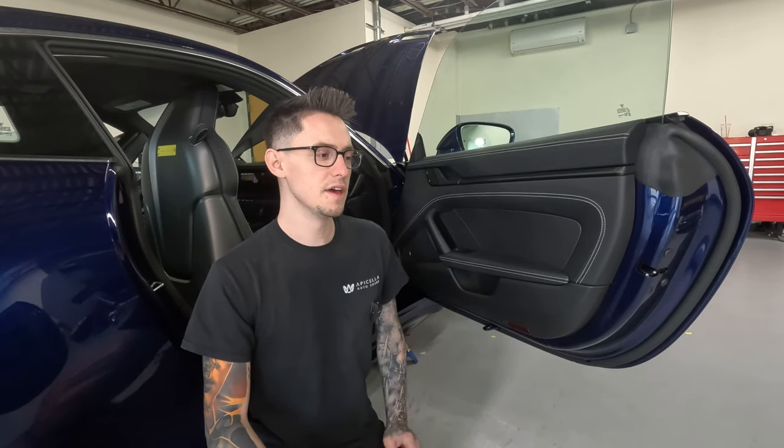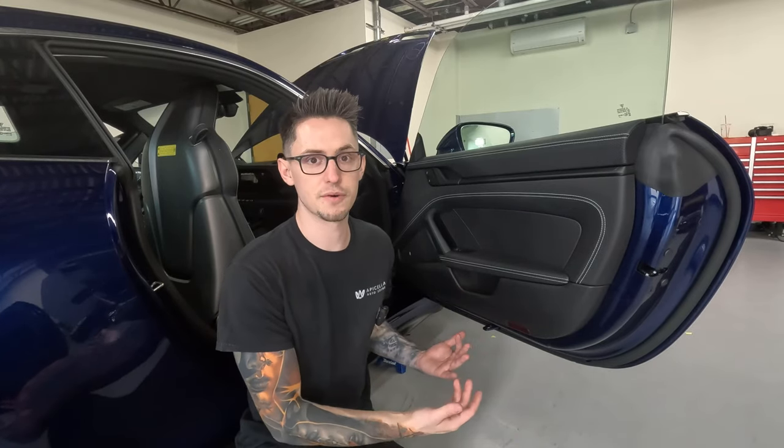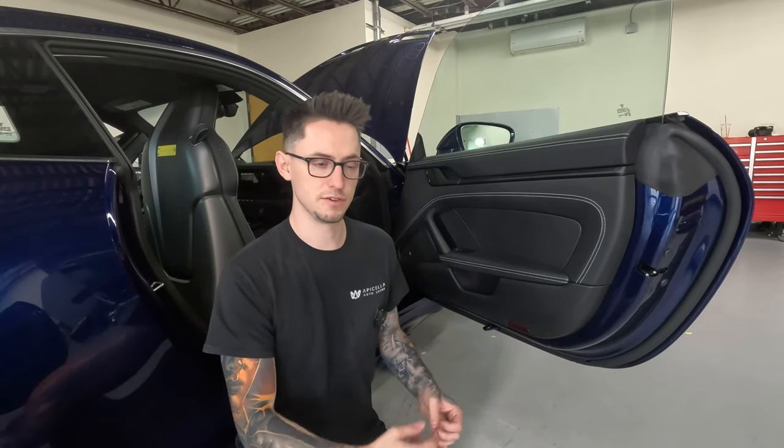The ResoNix CLD squares are a constrained layer damper. This is going to reduce structure-borne resonance on the outer skin. Resonance meaning, you know, structure-borne vibration. When a panel is vibrating, it's acting as its own speaker, so that mechanical energy in the outer skin is going to be transferring energy into the air, into acoustic energy. So that's what you're gonna hear. It is not going to block outside noise, and it's not going to absorb outside noise.